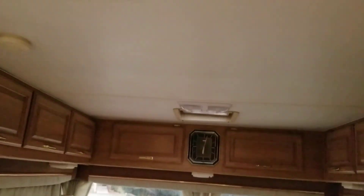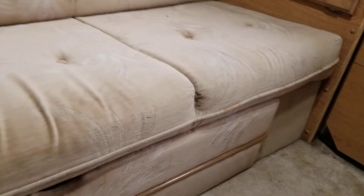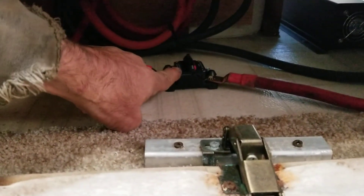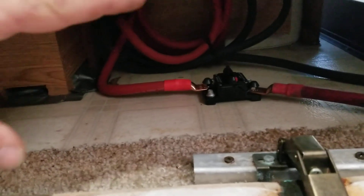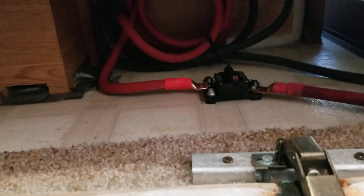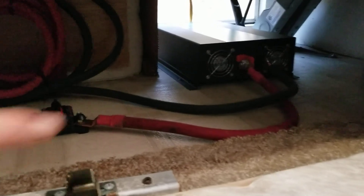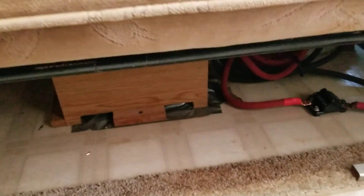Let me take you in here and show you what we did so far. The only place I could figure to put the inverter — I've got a breaker right here and the cables are 10 feet long, 2-0, because this is going to get used somewhere else after we're done with the trailer. So it's got a 2000-watt pure sine wave inverter there, and that redeems a little bit of the storage under here, which will help.